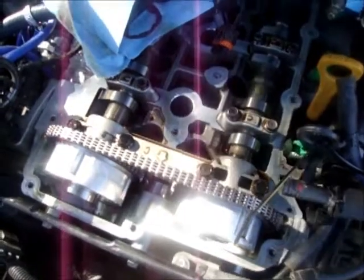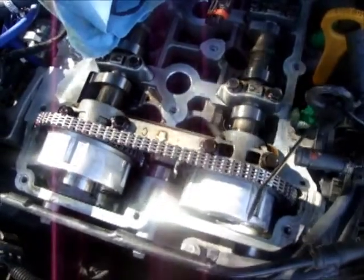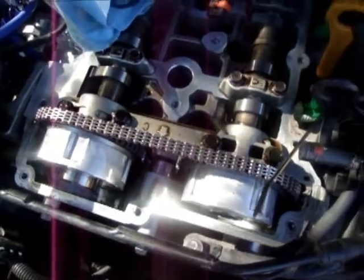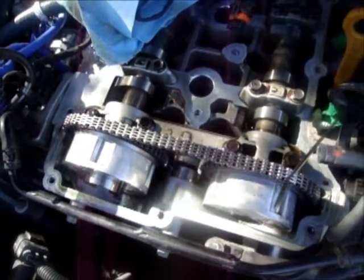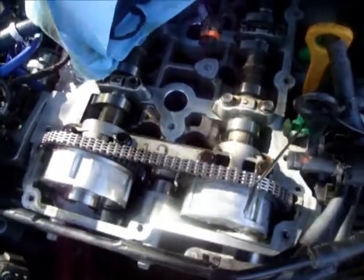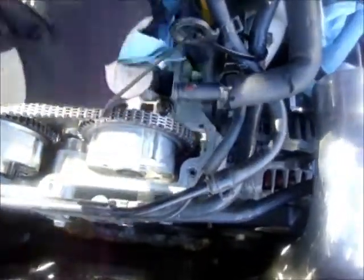It relies on those vents being under vacuum in order to get the vapors away and to create a mild amount of suction on the rest of the rotating oiled assemblies for proper lubrication. So while you may not notice that your vented-atmosphere crankcase is making any difference in power, the fact is you are slowly damaging your engines, because this is the way Hyundai designed it. A lot of companies are very big sticklers on how things are lubricated, and they're done that way for a very particular reason. Hyundai is no exception — they have decided that this is the optimal way for longevity on their engines.